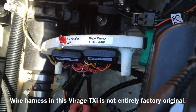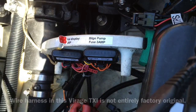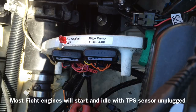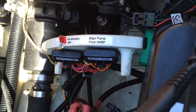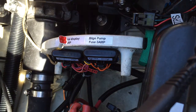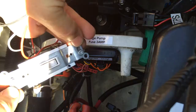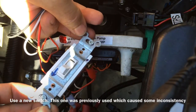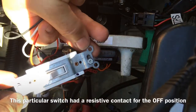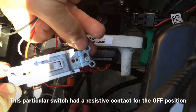On the top right is the TPS connector — you can see it is unplugged. I just ran the engine for a few seconds with the TPS unplugged and the exhaust temperature sensor unplugged. So now what I'm going to do is a very simple switch method of resetting the code. This is a standard household 3-way light switch.